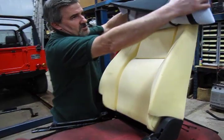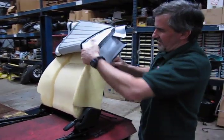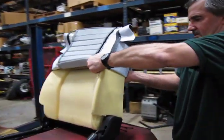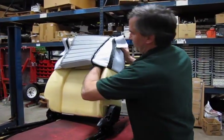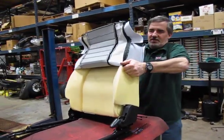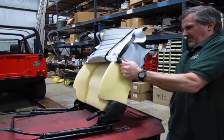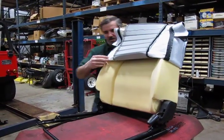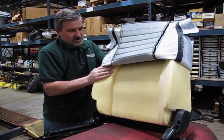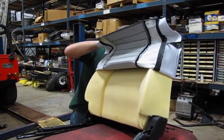There's the front of your seat. We're going to start by laying it over the top. The fabric is pretty pliable and you're going to be doing some stretching, pulling, and re-tucking. Once you get this over nice and tight, you can get your hand up in there if you need to push some of the foam over or relocate it so the piping lines up. Make sure the top is also down nice and tight — this takes a little tugging and yanking, a little bit at a time. It doesn't need a lot of force, just enough to get it down and seated in place.